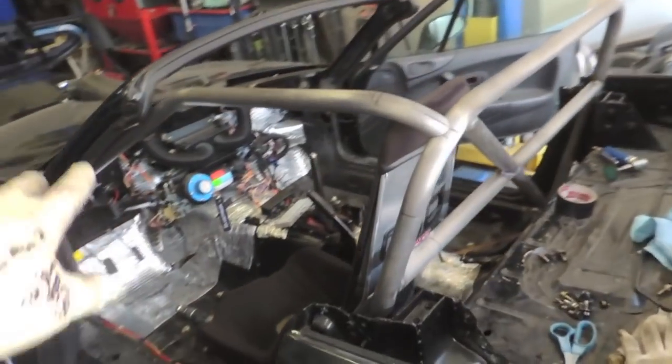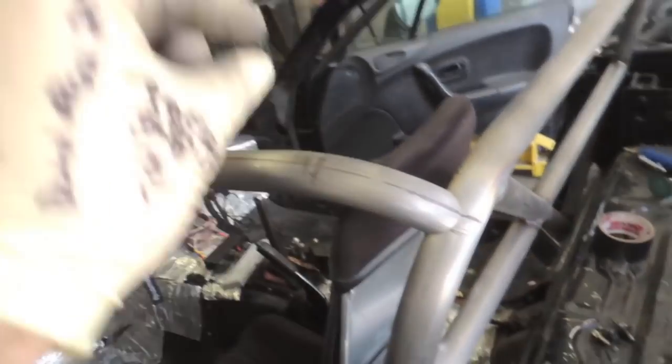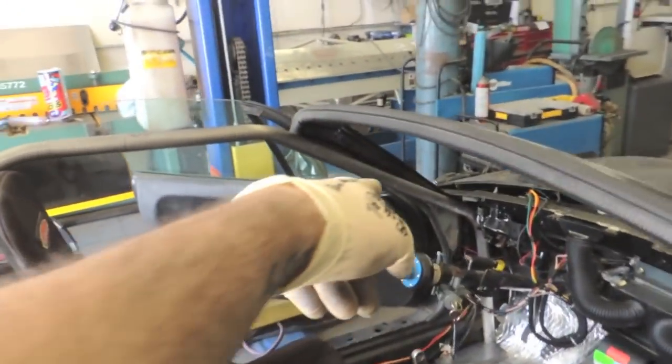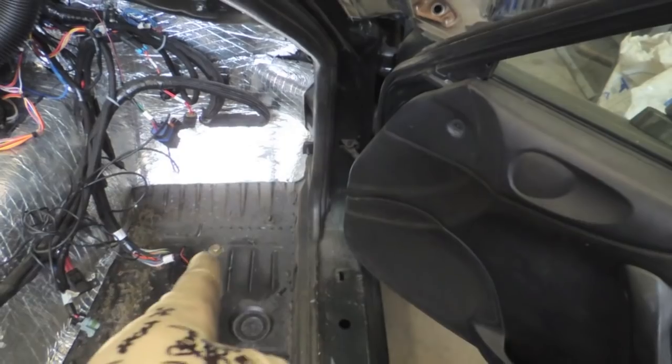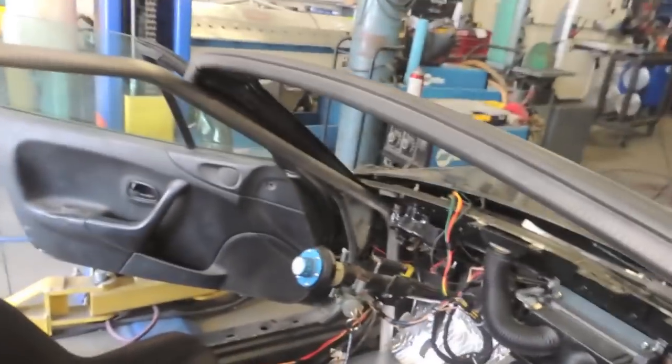Got those brackets cut out on the left and right side — now I should have a nice spot for the A-pillar bar to come down. Made a little progress fitting the driver-side A-pillar bar. Had to throw a kicker on it to clear the seat and it's an RCH away from the hard top. The rocker is actually inset from the pillar so I had to add a little kicker to get clearance for the base plate. It's basically touching the firewall up there — that bar took a long time to make, it's got four bends in it.